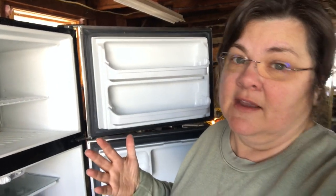She said manufacturers make heater kits for the compressors on fridges and freezers so that you can use them out in a garage. We didn't know this, and I'm sharing it because maybe you didn't know it either. If you do know it, you can just have a good laugh at our expense.